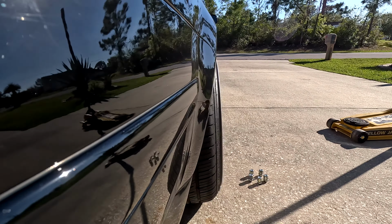All right, let's go ahead and roll the front fender just a bit. And so good, look at that. Woo, spicy. And for anyone who's gonna ask, the final wheel spec for the rear of the car is 19x10 ET41 with a 225/35 tire. And this is what you get. Again, when the car was static, it was 19x10 ET31. That extra little poke worked perfectly when the car was static, but now that it's bagged and the car's coming down more, the ET41 is really where you want it to be. So again, 19x10 ET41, there you go.